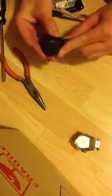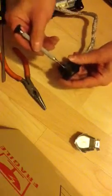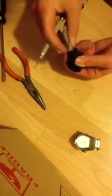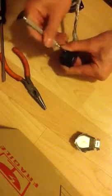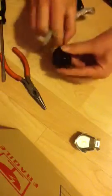So once you've got the shield off, you have to remove the black part of the socket cover. The same two prongs have two release tabs that again you have to release at the same time. You're also going to have to pry from multiple places and try to hold it open so that the tabs don't lock back in.